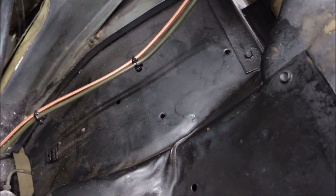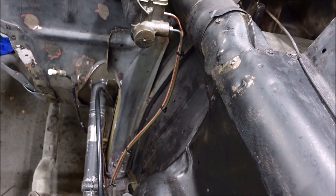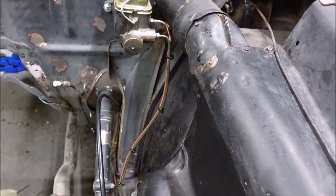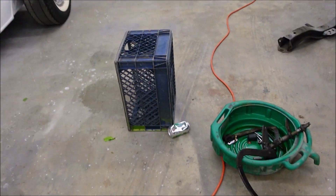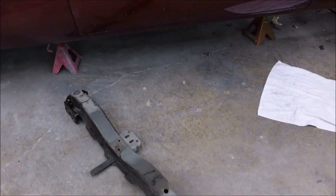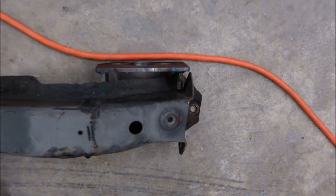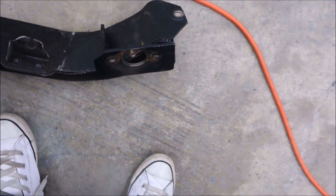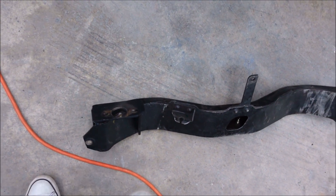Let's check out your permanent temporary brake line. As you can see, this is all done with the two-tone brake line option. Jimmy welded on this bracket — this was a single master, single pot before, so this converted it to dual.